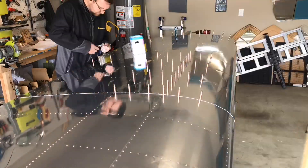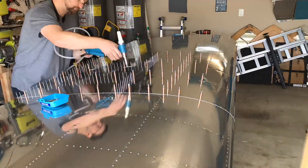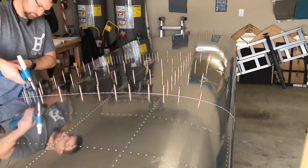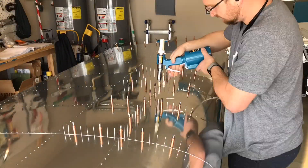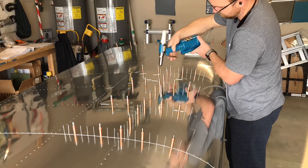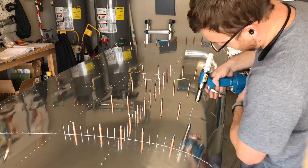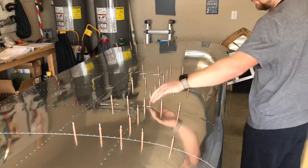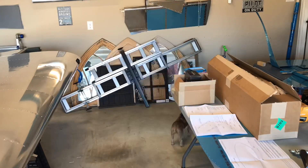It's nice to have other builders locally to me as well, so you get to see their projects come along and maybe have some flying partners later on. For the wing skins, make sure you're getting that vinyl pulled off and then deburring all the edges - there are some sharp edges on there. I actually made a mistake with the center skin: when I was riveting up the leading edge of the wing skins I riveted almost all the way to the back, which you're not supposed to do. You're only supposed to rivet about halfway up so you can fit the back wing skins in. It made it a little more complicated to get that middle skin in but I managed to work through it.